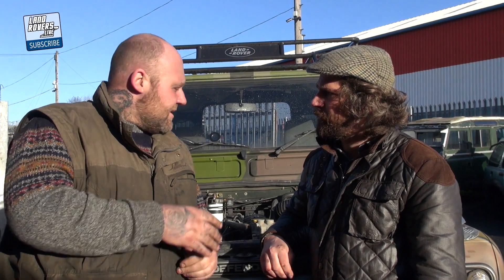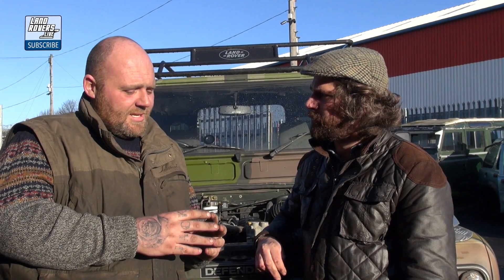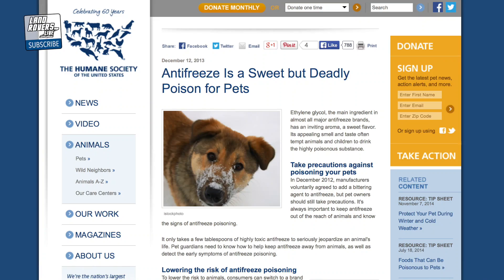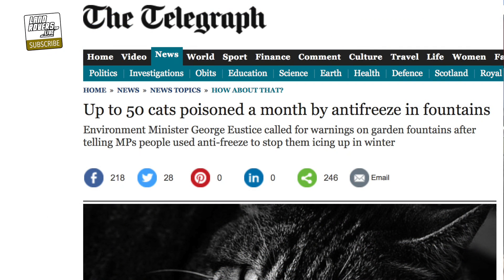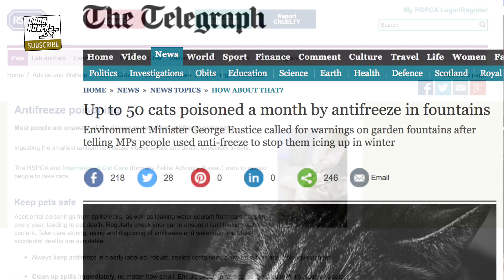And when the temperature drops too low in winter, you could get problems with freezing. Freezing water in the water jackets expands and cracks the block. Anti-freeze can stop this, but it's not very environmentally friendly at all for animals and other things like that. I've seen plenty of reports of it — cats dying and such.